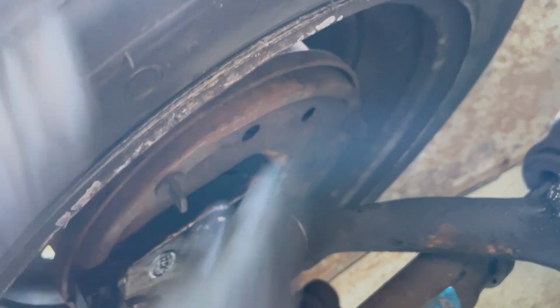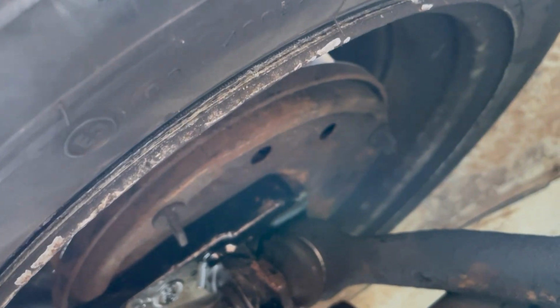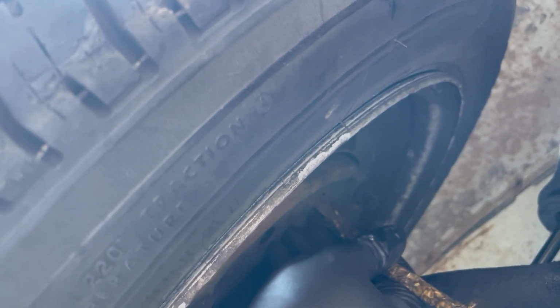What we've done is locked the wheel, and then we're going to back it off a little bit. I've done the top one first, the leading shoe, so I'm just going to back that off a little bit. It was moving, and what we're aiming to do is get a light drag on the wheel, so we're not aiming for a heavy drag, just a light drag, so we can still spin the wheel, but you can feel a little bit of a drag from the shoes. And once you're happy with that, I'll show you in a minute what I mean.